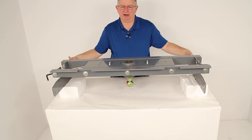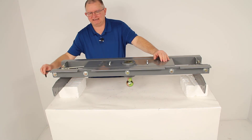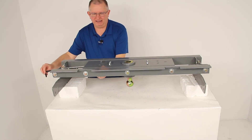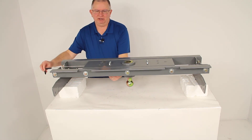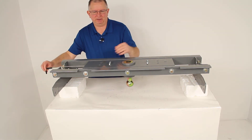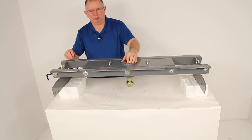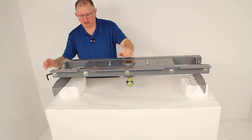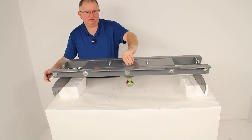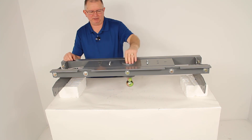Once you have the brackets and the center section all installed, you'll install this operating handle. This handle will bolt on right underneath here to a heavy-duty five-eighths inch diameter steel pin, and that steel pin is what secures the gooseneck ball or the mounting post of the companion fifth wheel hitch. With it turned over since we're not towing, take this handle and just twist it — it'll release that pin.